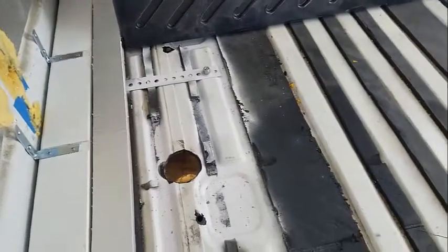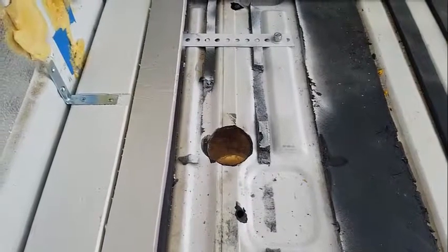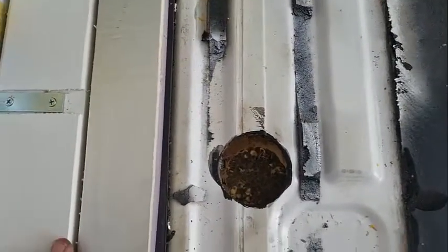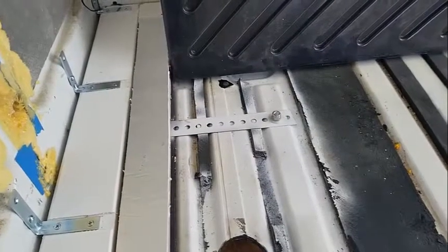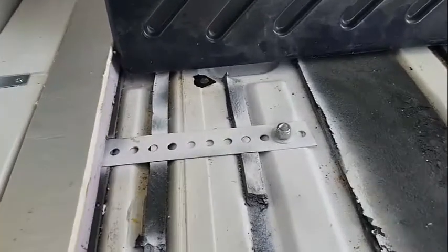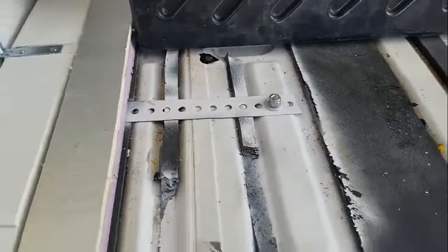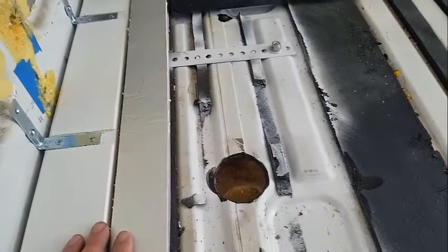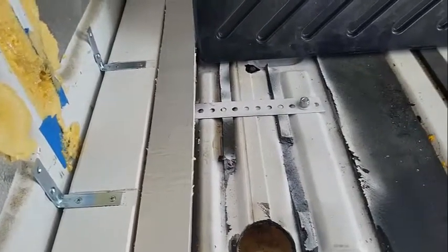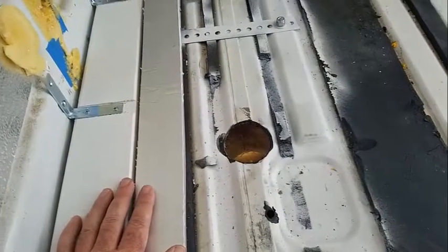I'll go over how I did this gray tank. It's a two and a half inch hole going through the bottom of the van, then I followed that up with a two-inch hole. I used an aluminum pan underneath to hold the gray tank. I used all-thread, lock washer, lock nut, and in addition to that being a lock nut I used thread lock so it doesn't come undone. I use a strap and there's another one over here — so there's a total of four of these coming down. The other ones are underneath me. That's the gray tank setup.